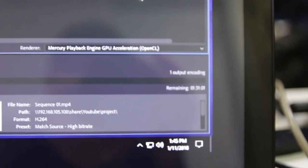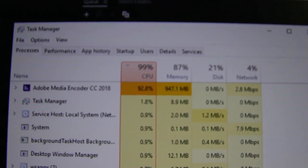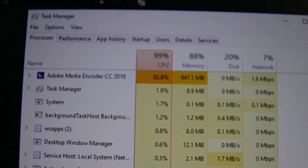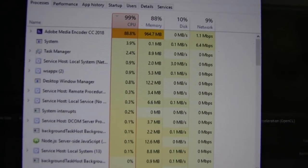Here's the final verdict: with this graphic card it's about an hour and 30 minutes. It's really being bottlenecked now by the CPU. You can see the CPU usage is really high — that's what's causing the limit on the hour and a half. I don't think it's the GPU anymore; it's probably the CPU. So that's probably the best I can get with this type of setup.